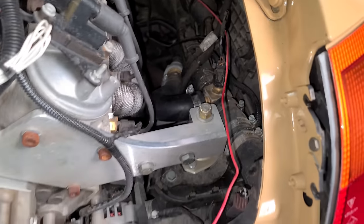So it's utilizing three. One of the first steps in diagnosing a car that overheats in the city, but not on the highway, would be the fans. Because you don't really need the fans on the highway. After about 30, 40 miles an hour, the fans shut off on most cars and the air that's coming in through the front is more than enough to cool off the radiator.